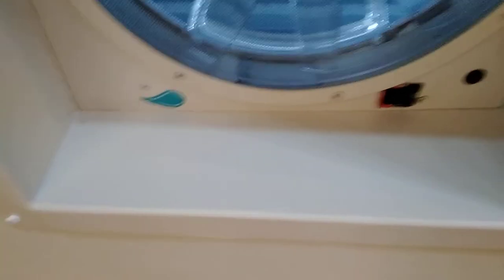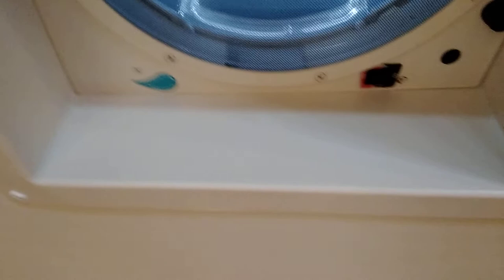The Fantastic vent switch is right here and your controller is here. Turn it on and it puts the vent lid up. It has a rain sensor — if it gets wet it closes automatically. There's a switch to disable that. The rain sensor is so sensitive that a heavy dew or even a bird dropping on it will close your vents, which is why you might want to disable it.